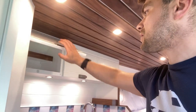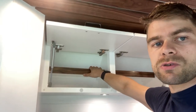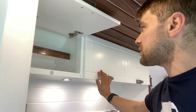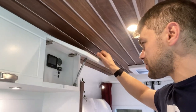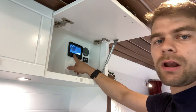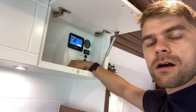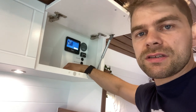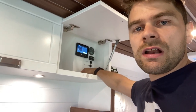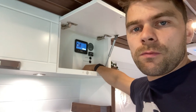Moving back, there are overheads above the kitchen unit. In two of these the customer has asked for a shelf, so there's a walnut-fronted divider shelf where you can put mugs on top and plates and crockery below. These are all on gas struts and Blum hinges so you can remove the doors. The third overhead cupboard features our control panel. We've got the Truma Combi D4E, which is the diesel boiler — a really nice piece of kit that enables you to tap into the vehicle fuel tank for the fuel source so you're not having to find LPG filler points too frequently. There's also the Victron 712 battery monitor, which is really important to monitor your electrical usage inside the van.